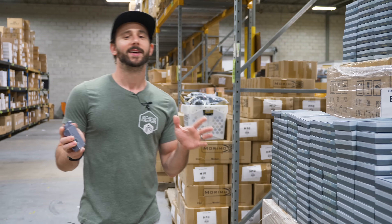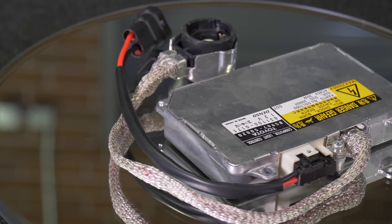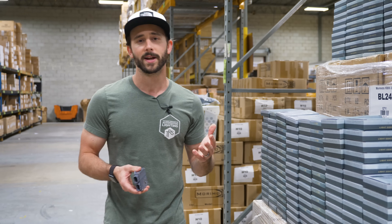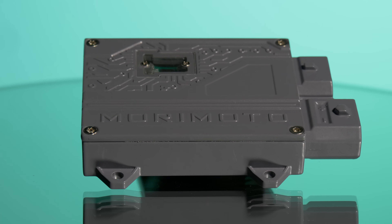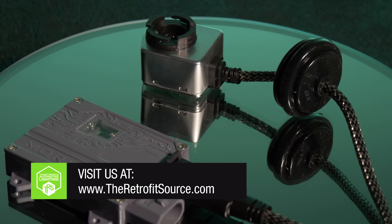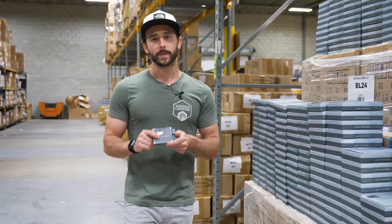Once you've picked your projectors, you've got to power them up with a set of HID ballasts. There are two main choices: OEM or aftermarket, and 35-watt or 50-watt. OEM ballasts are great — used by Toyota, Lexus, Infiniti — but they're not waterproof, and you want something waterproof when mounting in the engine bay. Aftermarket ballasts like Morimoto or Hilux are completely waterproof and can go anywhere under the hood. I prefer the Morimoto ones — completely modular with different outputs, you can use an amp or a D2S igniter depending on your projector, all wiring is plug-and-play, and they're small, compact, and very reliable.